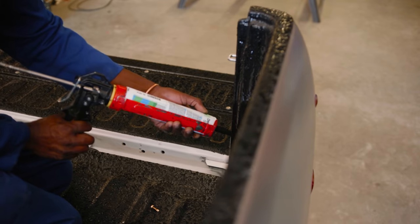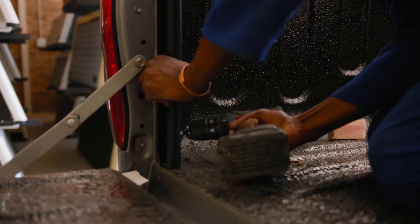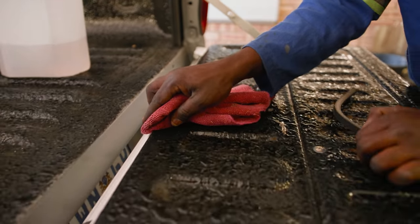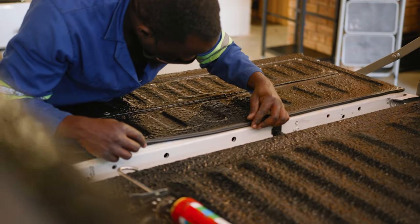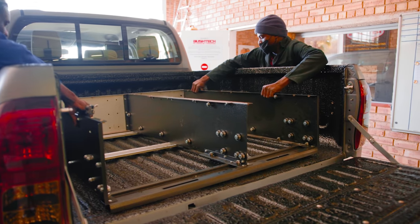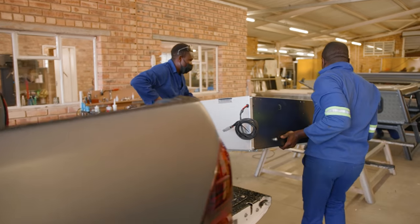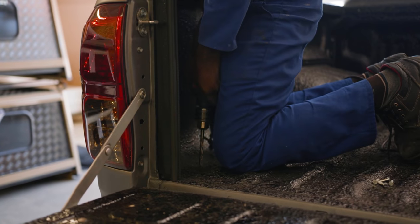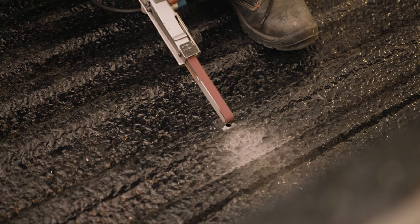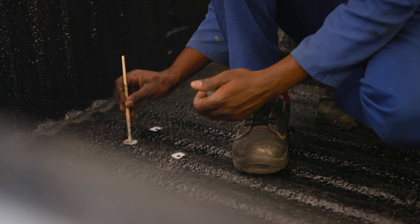The dust seal kit will form the foundation of what's to come, having a clean sealed environment for the drawer system to sit in, keeping the fridge and all the other valuables clean on those long off-road trips. They do need to drill into the tub to safely mount the drawer system, but the attention to detail they've paid to the process was impressive. Priming and painting the drill holes to prevent future rust is an important step, because rubberizing has a tendency to rust underneath and you don't even know it's happening.